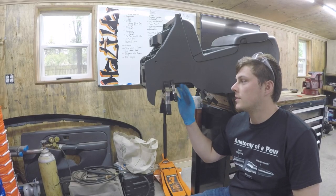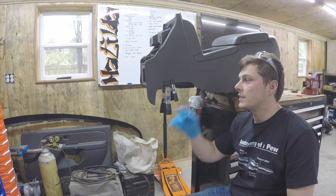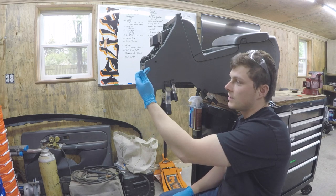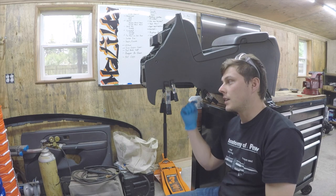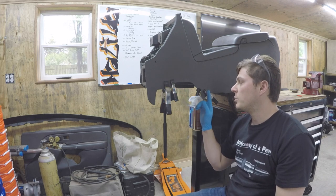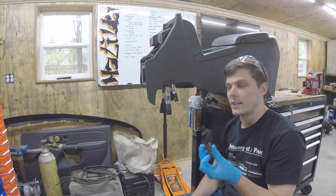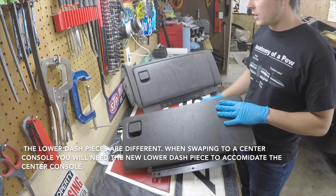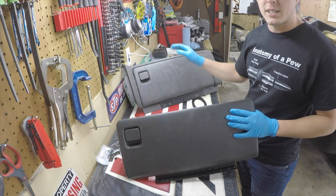Just to give you a heads up: when you do trim this, it is a double-layered section — there's two pieces of plastic, you have the inside shell and then you have the outside skin. There are little plastic anchor pieces that go in the top hole that are supposed to keep that skin tight to the inside shell, but there are two little tabs that hook into the inside shell that you actually have to cut to get it notched out, so this bottom piece is pretty floppy. To fix that I used some double-sided gorilla tape — two pieces here and a piece back here — clamped for about five minutes. Then we're still going to insert the little plastic anchor up in the top. Now we're going to install the lower dash pieces — this one is out of the donor truck, and this is the glove box out of my truck. We're going to drill these rivets out, swap glove boxes so I still have the correct info sticker on the inside, then get these cleaned up and put in the truck.